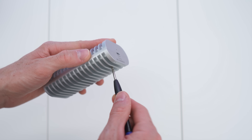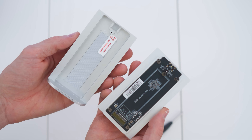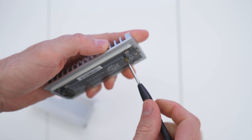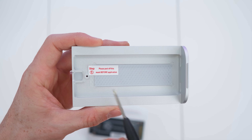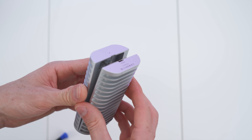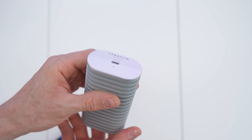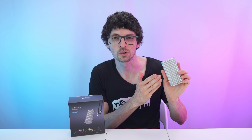There's just one screw — remove it and the enclosure simply pops open to reveal the inner compartment for the NVMe SSD. The screw stays inside so you won't lose it. It's a great design. After inserting the NVMe, you peel the thermal pad backing — the second pad is a spare — and it's really as simple as that. The two halves click together with these little protrusions fitting into cutouts, sandwiching together with really tight tolerances. Then just screw it back in.